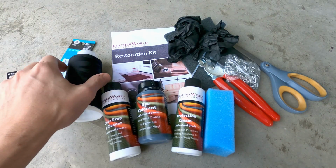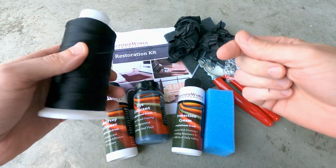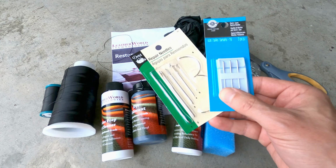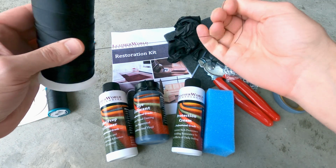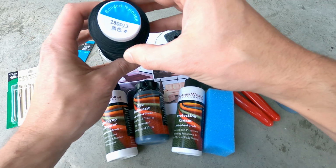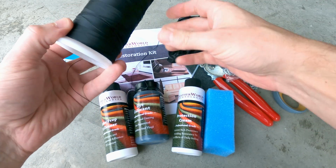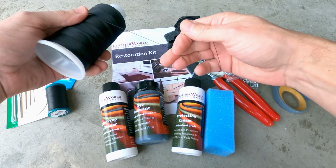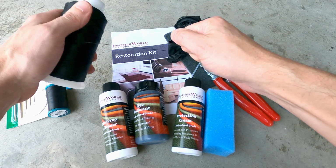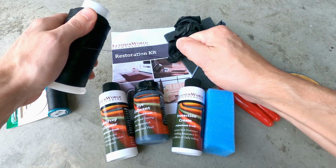In order to care for these items, you'll need some replacement thread to match the interior color of your car and some heavy-duty hand sewing needles. Because of its overall strength and elasticity, nylon thread is a good choice for automotive upholstery. It's also important to pair the right thread size with the thickness of the material being used. Thread sizes of Tex 90, 135, or 210 are commonly used for car interiors.